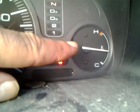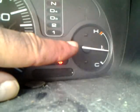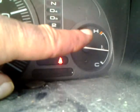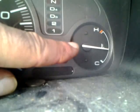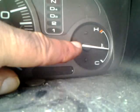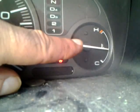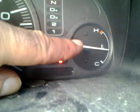Here's what I want to get across: our temperature gauge is running in the proper range, about halfway up. Up by the H is the little red zone — the part you never want your needle to go to, and really you don't want your needle to get close to that. What you need to know is that when this gauge gets up to a certain level, a control circuit is going to kick in and operate our vehicle fan for the engine.